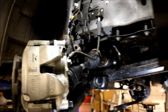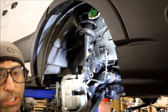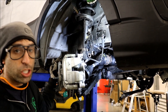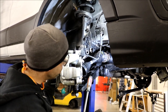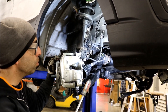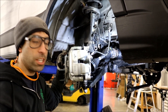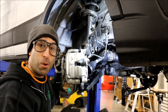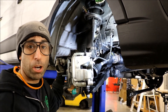We're going to work through this. We'll have a solution for you guys real soon, and it should be a really nice solution that everyone's going to be really happy with — an easy install that addresses all these issues so that when you put the lift kit on the van, you can get the big tires on there without accelerated wear issues that cheaper lift kits induce. Those kits don't address the fact that factory control arm bushings and steering components have limits, and overextending them is when wear starts and clunks happen — that's why lift kits get a bad reputation. Not here at Van Compass. Stay tuned, and we'll keep you updated when we have a nice solution for these 2020 all-wheel-drive Transits.